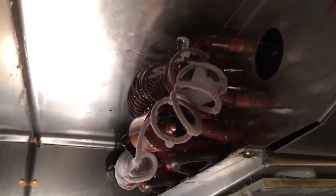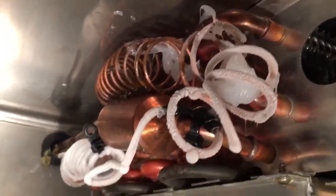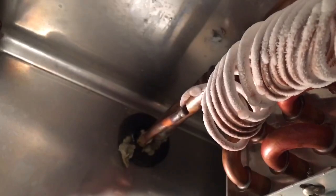This is some weird stuff. It's metering — it's expanding right there. The cap tube is all frosted up. That cap tube must be restricted. She's sucked down into a vacuum pretty good, so it's gotta be restricted, that's for sure. She ain't feeding — she's metering back here, from here all the way to here. That's a strange one.